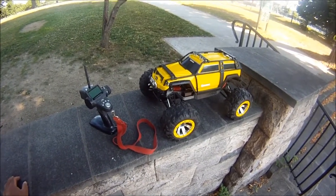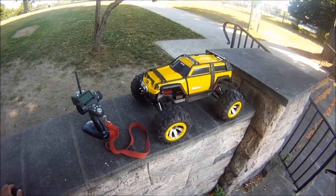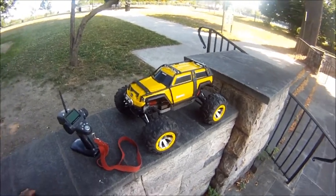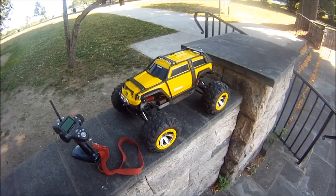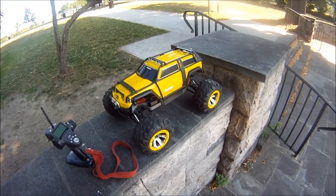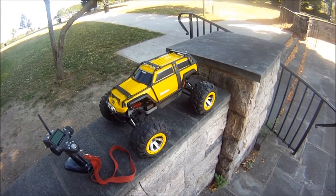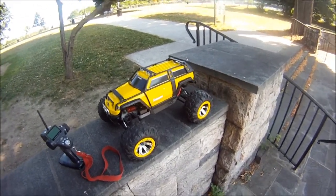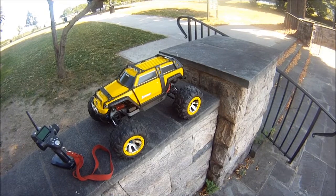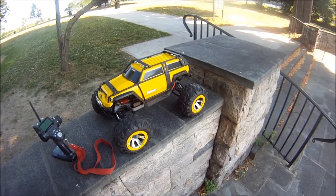Okay, and as you know, the Traxxas Summit is not a regular truck like any other truck out there. This truck works with a four channel remote. The remote that comes from the factory on this truck is the TQ4. So you control the basic things that you control in any RC vehicle, like steering, brake, and throttle. And also you need two extra channels to control the two-speed transmission, so you can shift to high or low gear. And you need the fourth channel, that's the one that you will use to control the diff lock feature